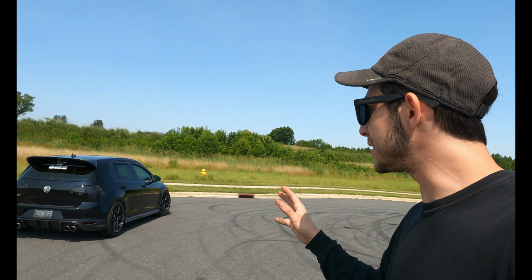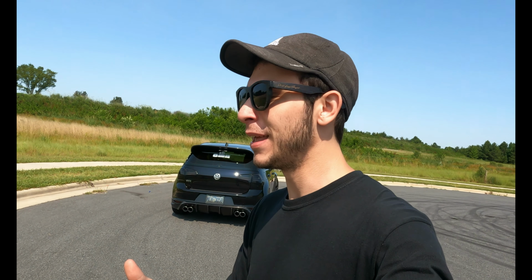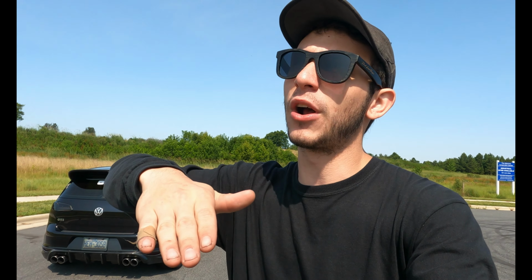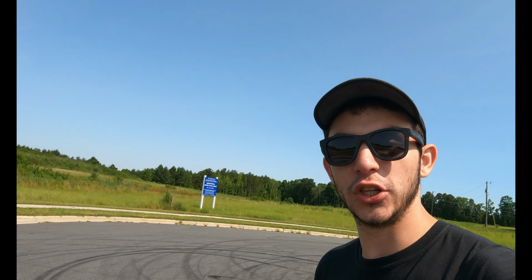The fronts, on the other hand, are a bit trickier. There is a method I saw on YouTube, from Bryce Jordan Productions, I believe. Most people try to pull out the axle when doing coilovers up front. They want to drop the axle to release the knuckle from down low so they can get the strut out. Rather than messing with all 8 or 12 of those bolts on each side and torquing them all back down one by one, get yourself a 2x4. As long as your car's on a jack stand and you have a jack available, you can use that 2x4 to compress the strut.